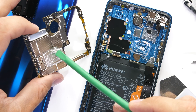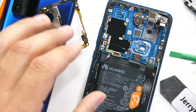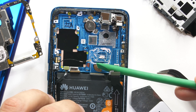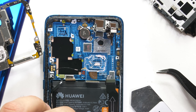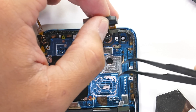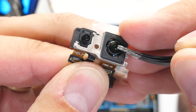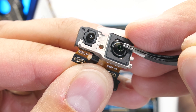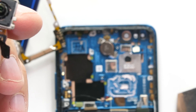Moving to the back of the motherboard, we can see that there is thermal paste between the board and the frame of the phone. It looks like Huawei is using the same under-screen vapor chamber we've seen utilized in other devices lately. It is easier to get rid of heat through the screen than just using the frame alone. Looking at the front facing camera, we can see the 32 megapixel selfie unit alongside the infrared 3D camera for face unlocking. The selfie camera does move around a bit, but there is no OIS, just auto focusing.